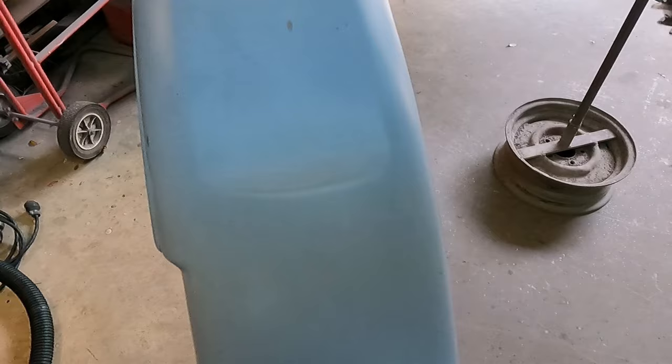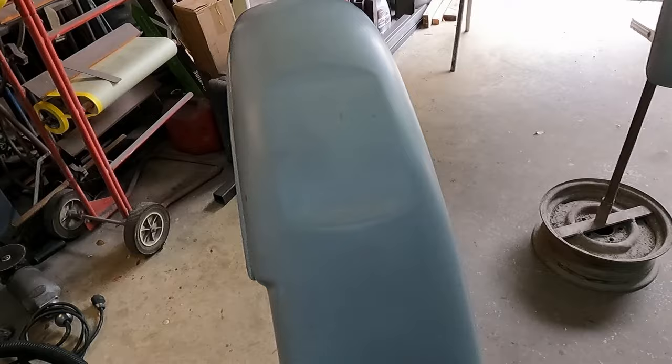What I'm going to be doing now is going ahead and putting a base white down for the stripe on all the tins here. I'm not painting the whole thing. I'm just going to do basically 4 inches, and that'll call it a day on that. Now we're taking the old spray gun, shooting some white down to get the underbase. Yeah, we want a nice bright white foundation for the orange that we're going to put on next.